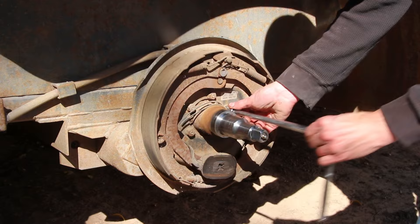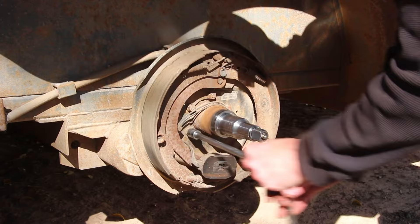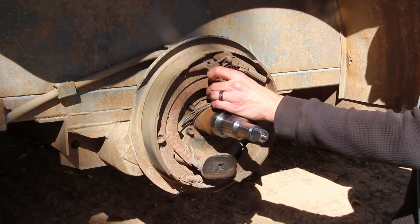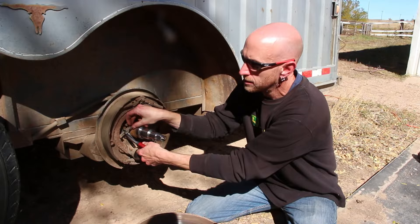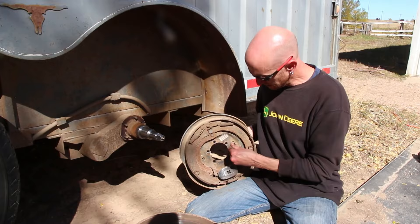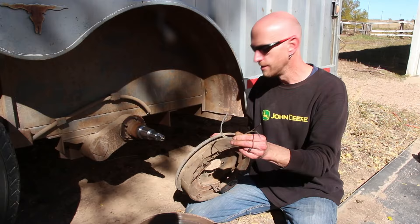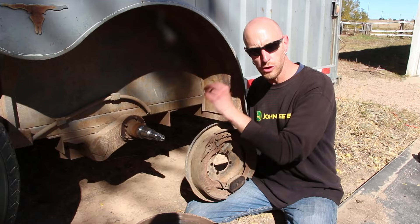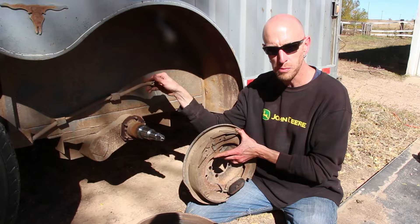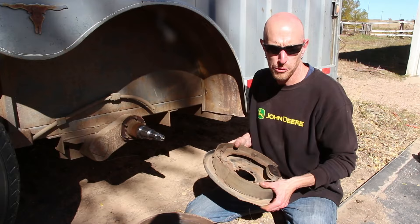Please dispose of the old backing plate properly. There's a nut and washer you want to keep track of because we're gonna need to reuse them. Now we'll just grab a pair of wire cutters and cut the wires that run to the electromagnet — yes, it's that easy. When I pulled this one off I realized the wires are already cut, so no wonder they're not working. I like to leave as much length as I can and shorten them up later, to have plenty of cable length to get everything routed nice and neat. These ones had broken right there, so we're gonna have to splice into those — but not a big deal.